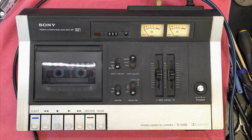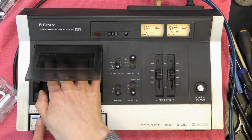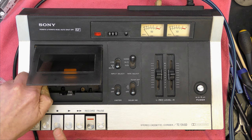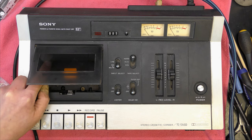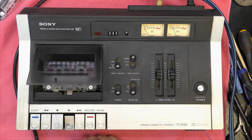Okay, so two things it could be. Could be that there's a problem with the record or playback switch, because I notice the VU meter keeps going up and down — that's usually a good sign. So I'm going to shove it into record mode and just see if that clears it. I'm pushing in the record protection tab so I can push record down. I'll see if there's any difference, see if I get the other channel now.